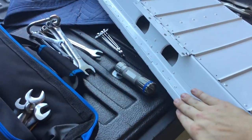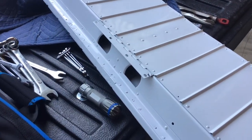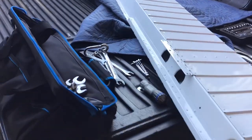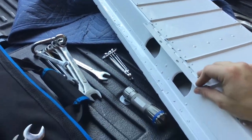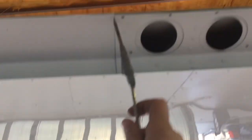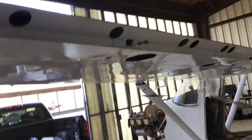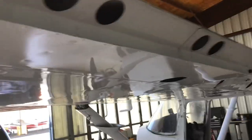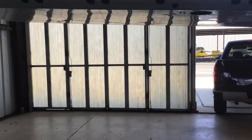You'll notice it has this giant strip of lead right there — that's for balancing it. I already had a chance to check to make sure it was within specifications last week up at the school. I think I have a plan for these hinges. I'm going to try to put in the outboard side with the pin through it like this, pin it in right here, and then once I get it pinned there, I'll see if I can rotate it into place and put the center hinge in and then the inboard hinge in. I don't know how well this is going to work — see if I fail or if it works great.